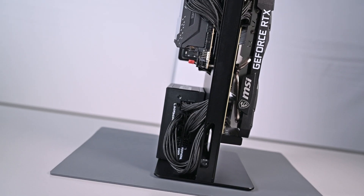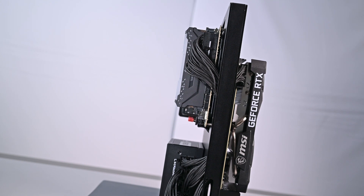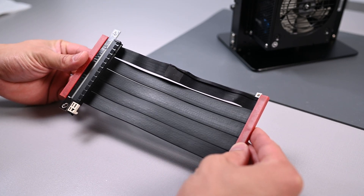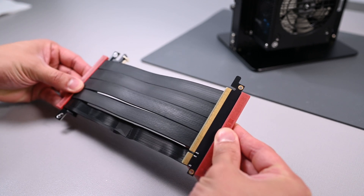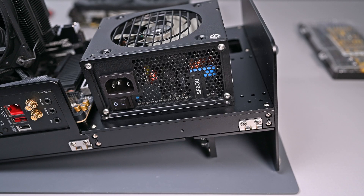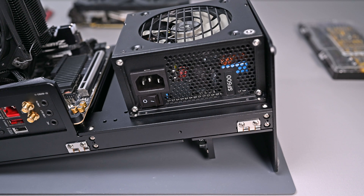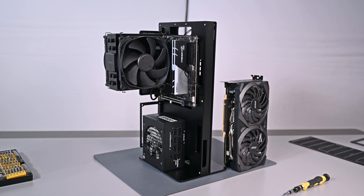For the graphics card, there are no clearance limits and you can fit a full-size triple fan GPU if you want. For the riser cable, it's best to use one that has reverse ends so it's easy to secure into the case and accommodates the required bend — I'll have links in the description below. Additionally, there's room to mount up to three 2.5-inch SSDs below an SFF power supply, or one 2.5-inch SSD above it if you slide the power supply down a notch, giving you two SFF mounting options.